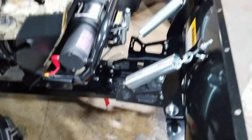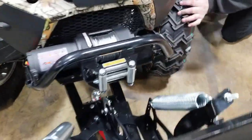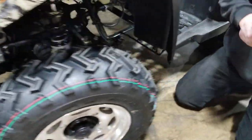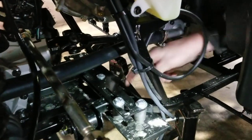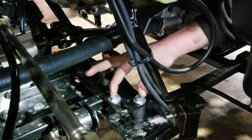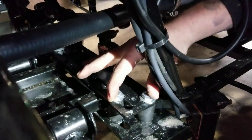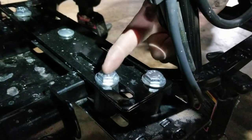Okay, and then how are we actually going to mount the ATV — the left side of the vehicle — with the plow? To start out, you want to make sure you have a good mounting point right by the frame. You can see here we have the frame rail running right along it. It comes in and hooks over, so you're going to install the plate in a fashion like this, where your bolts are kind of tapered.